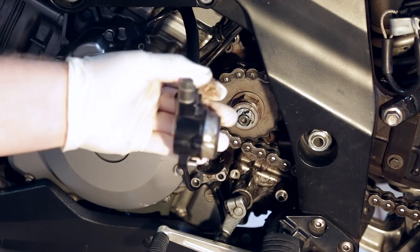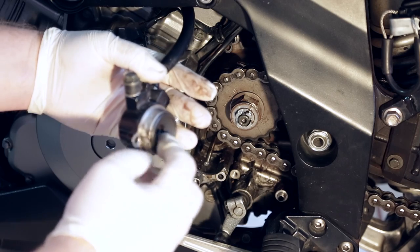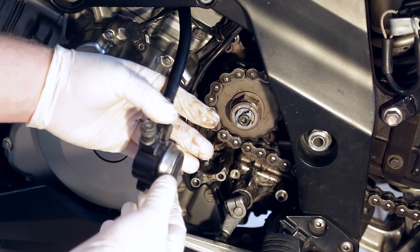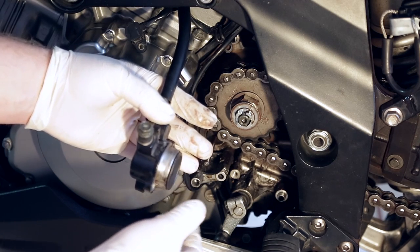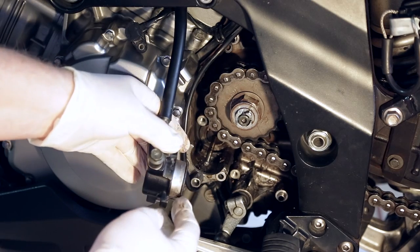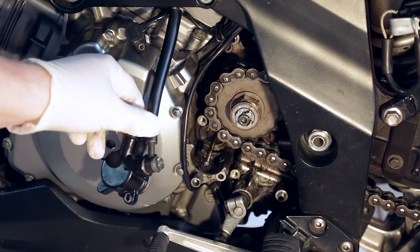That's how to remove everything. With the clutch lever pulled in, the piston won't pop out. This is the clutch slave cylinder piston in here. If you let off on the clamp, it's going to slowly start sliding out and eventually the piston will pop out — then all your brake fluid is going to go all over the place and you'll spend another 20 minutes bleeding the line. You can do this in reverse also — you can leave the pressure off the lever and put a clamp around the cylinder too, but that's just more stuff in the way, so I like to do it this way.